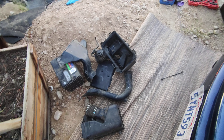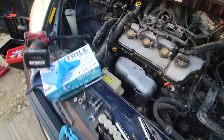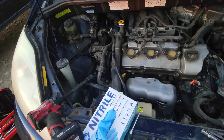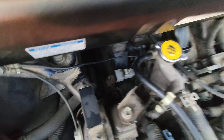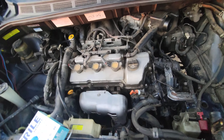I had some trouble with my '04 Sienna today. It was overheating on the side of the road, and I got out the scan tool. I did a little diagnosis that said the temp sensor might be an issue, and I popped that off and actually replaced it, and noticed while I was doing that the coolant level was low, so I added some more.